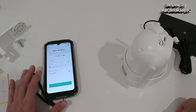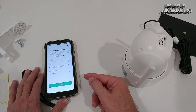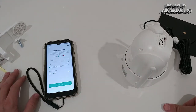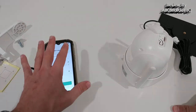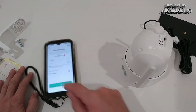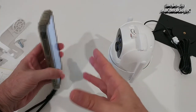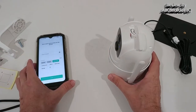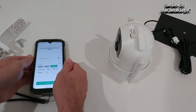Select the WiFi and provide your router password — it's not a password for this camera, it's your normal router password. Also make sure your phone is already connected to the same 2.4GHz WiFi network to prevent connection problems. After connecting, you can select any WiFi on your phone — 3G, 4G, 5G — it doesn't matter. Click 'Next step,' get the QR code, hold it in front of the camera, and we already get confirmation that WiFi is recognized and connected — super fast.